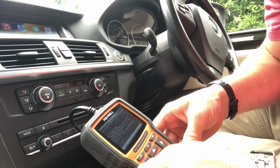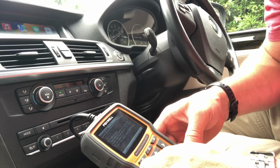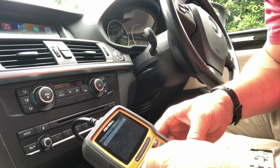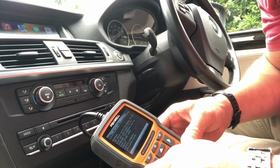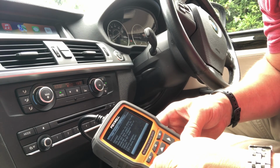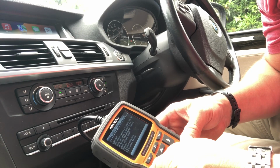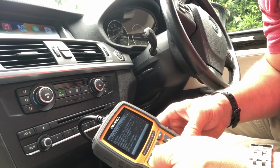Make sure the ignition is switched on. Make sure the cables between the tester and the vehicle DLC are connected. Check the vehicle battery is charged. Okay. Important: this service function only initializes the rain sensor and newly adapts it to the windscreen. Initialization does not impact the light sensor. So perform initialization or end service function. I'm going to perform it.